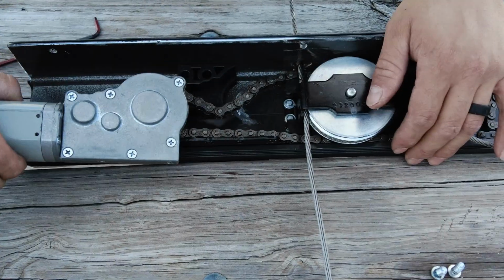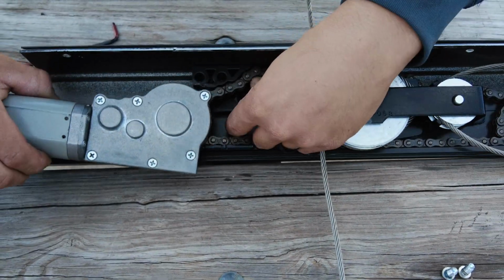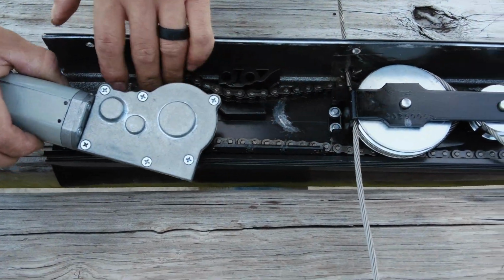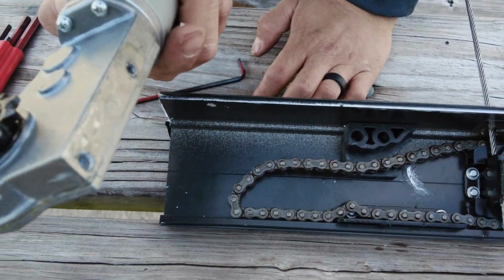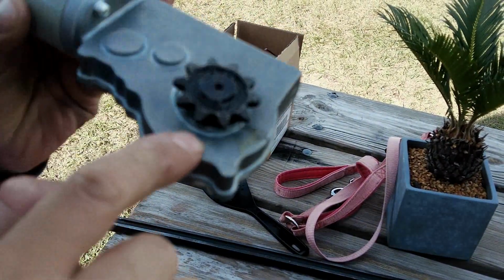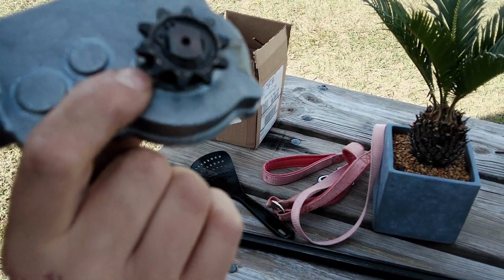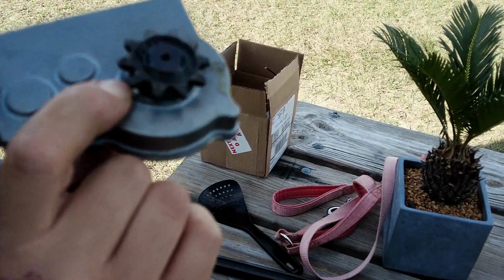to pull the chain up, and then okay, the moment of truth, what this gear is going to look like. It doesn't look bad, so the damage is probably internal. So there's some sort of locking washer internally that on this end is very close, on this end is very far. So something has definitely shifted within the gearbox. So something failed within the gearbox.